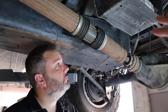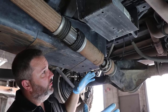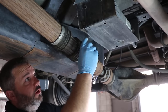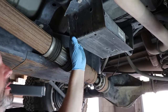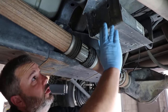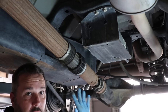I've lost both boots on my drive shafts. Mike, tell everybody why this happens. When you put a lift on and add a longer track bar to compensate for the lift height, when your suspension cycles it pushes the axle further over than it's designed, so you lose clearance between the evap canister shield and the drive shaft. It rubs and rips the boot. The new drive shafts are a smaller diameter so you'll have plenty of clearance. You can also drop the shield down and move the bolt holes over about an inch, and move the evap canister over about an inch — even with a stock drive shaft that'll give you clearance.